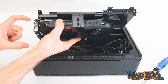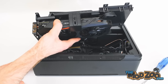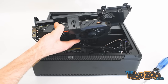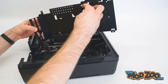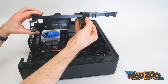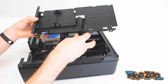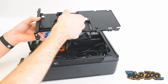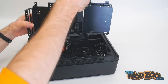From the PCB on the graphics card to the bottom of the chassis, not including fans, is 68 millimeters. So if you don't have fans mounted in the bottom you need a pretty thick graphics card. With 15mm fans in place you'd be down to about 53mm. You can fit full-size fans in there though. There's a nice little path to route your graphics card power cables, and a little recess so the wires can lay flat if you have flat cables.